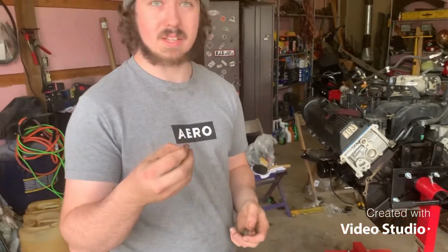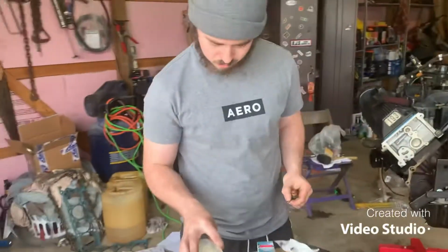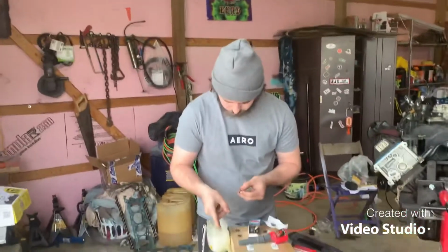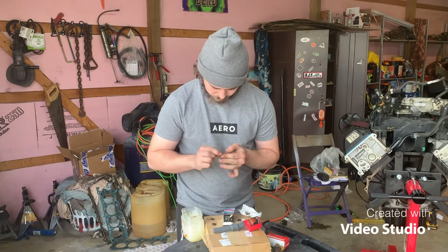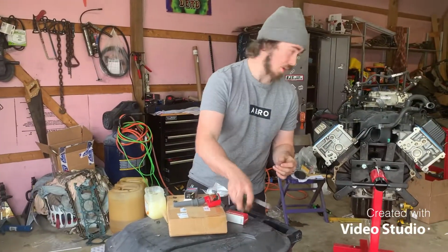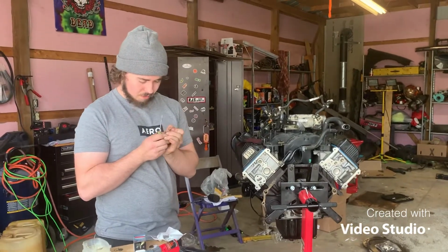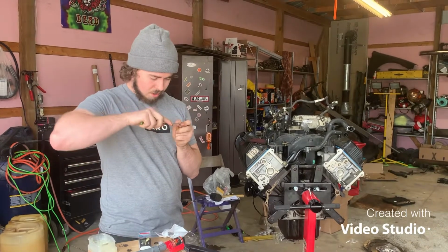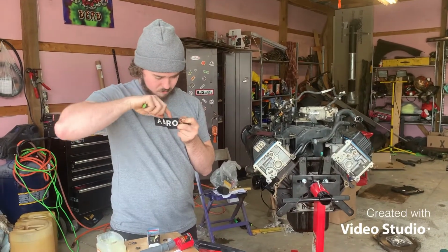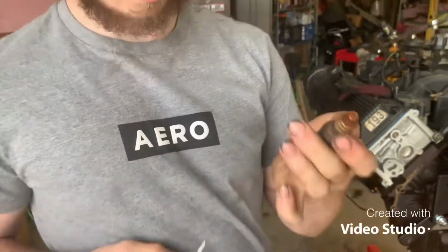I put a tiny bit of Vaseline on them so they go on easier. Just bring it over here. Oh, there goes my pick. I just take a tiny bit of this. Helps them not to whip, and it helps them go on easier, and helps them go in the fuel rail and the intake. They sit into the intake, so it helps it go in there easier. Definitely over this one, because this one's big to go over. So then I just put it in there without poking it, and just peel it around. Just like that. That's a new one.